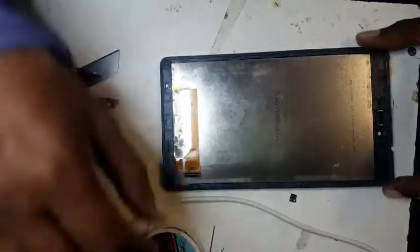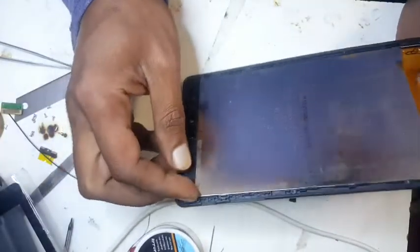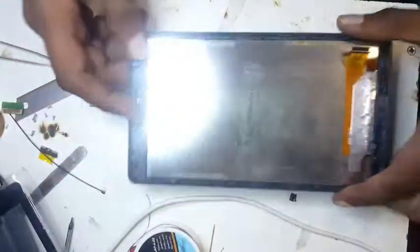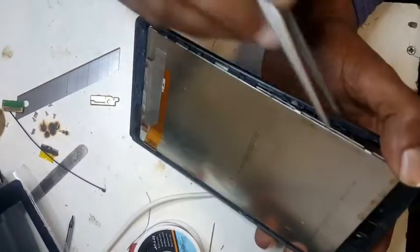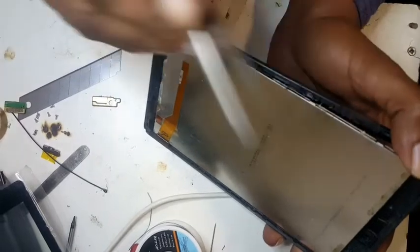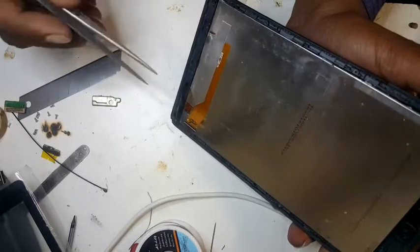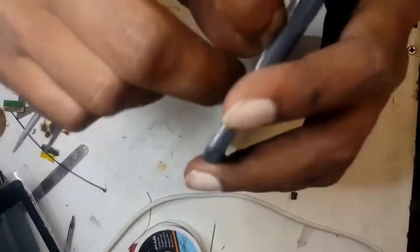We can put the board aside now and just push the LCD a little bit. If it doesn't come out, heat it up from this side so it can loosen up the grip. I'm going to heat it up a little bit. You can see the reason for opening it from the back and removing everything first. I think somebody replaced the touch before and put too much glue, so just heat up all around it until it comes out nicely — we don't want to break the LCD.